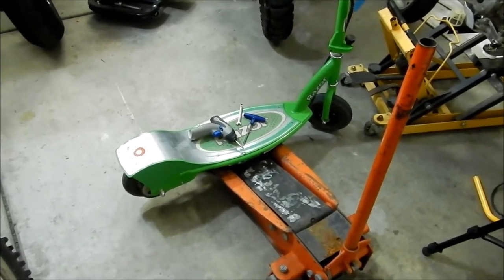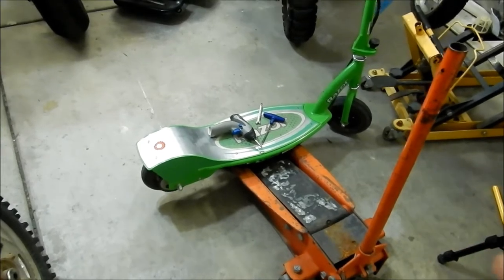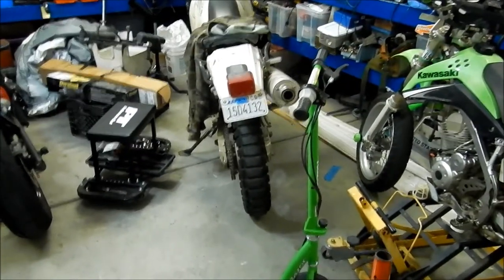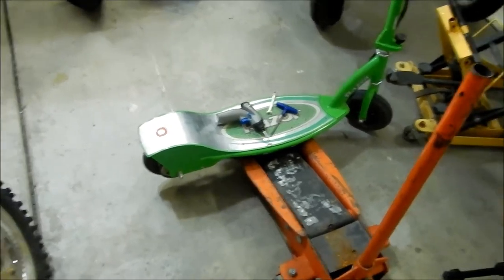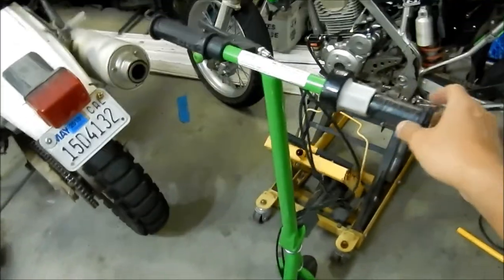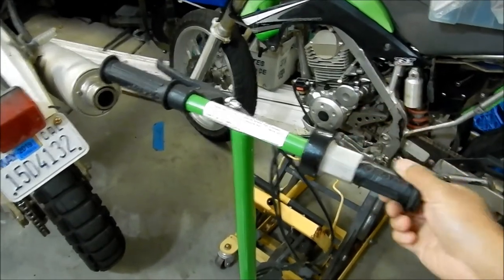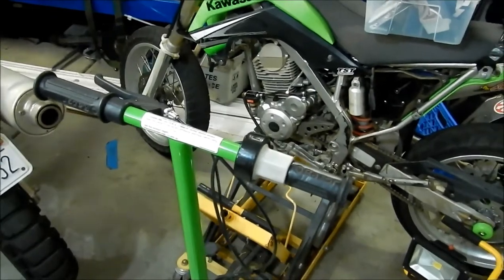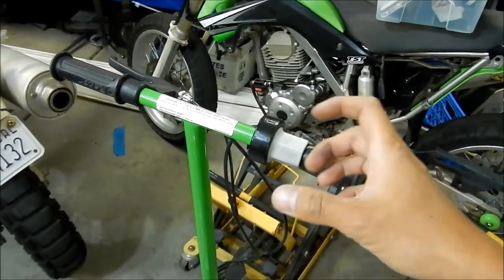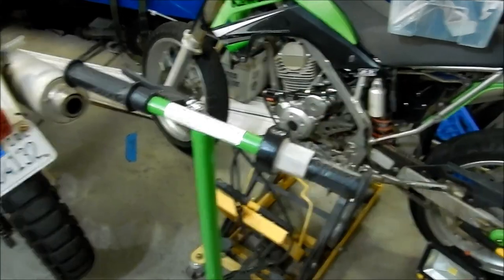I'm starting a little vlog - it's kind of a how-to vlog. Basically what I'm going to do today is add a new controller and throttle grip to my Razor e200 scooter. The Razor e200 has a horrible twist throttle - it's a half throttle setup. Half of it is a twist throttle and the other half is a grip, and it works as basically an on-off switch. Once you twist it, it turns the motor on and that's it - there's no half throttle, quarter throttle, ten percent - it's zero or a hundred percent.